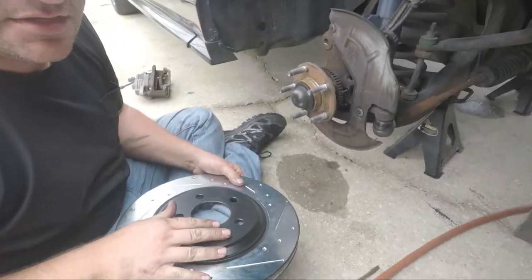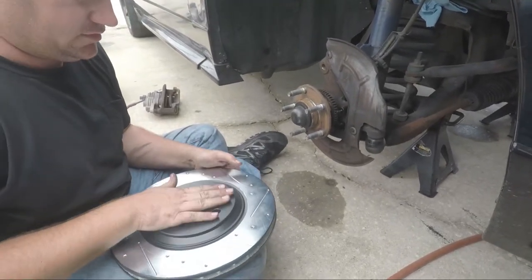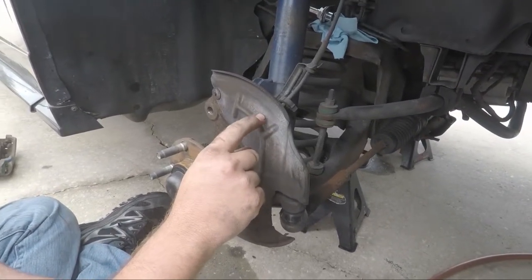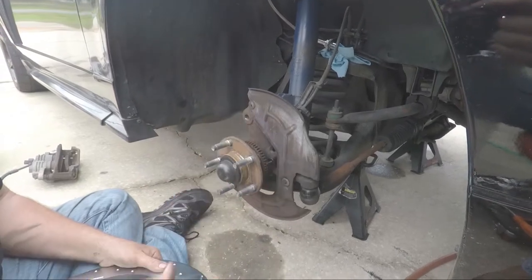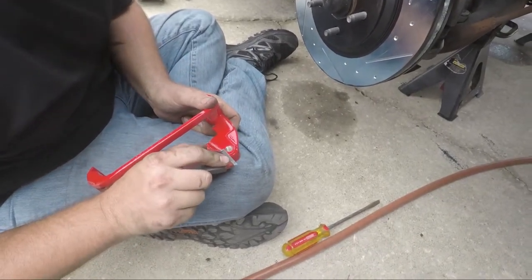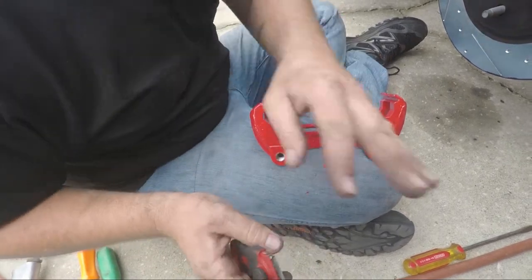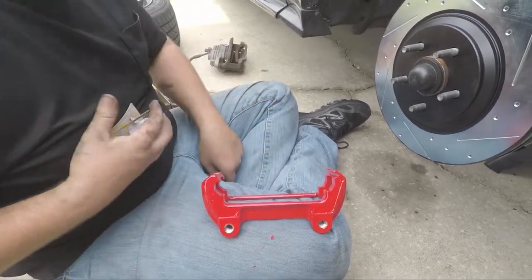When these come they aren't painted, so you saw Willard painting those — painted the outsides and the centers so they don't rust. They are labeled, so you want to make sure the grooves are going in the right direction. Another thing to call out: the backing plate — we looked these up and the backing plates are the same for the Cobra and the GT; same part number for both on OEM Ford websites. So taking these burrs off from the paint. The Dorman 13898 bolts sit flat on the surface.